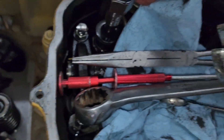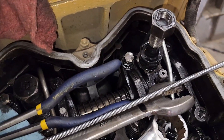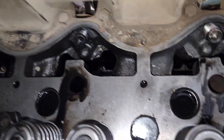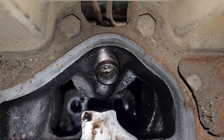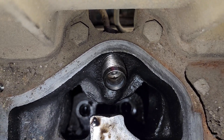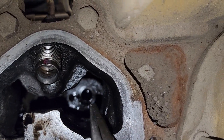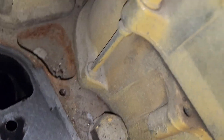I tore some of this stuff down. We took this top housing off, we took the lower housing off, I took my fuel lines off, then I removed these three bolts — studs down through there — pulled out our rockers, and then we pulled out our tubes. Now you can see down in there. There's a little black dot right down there — it should look like this one over here. There's a lock right there.